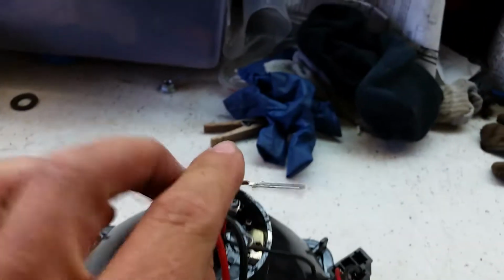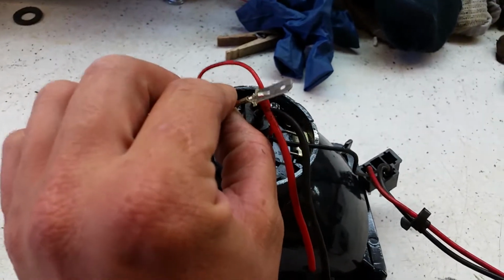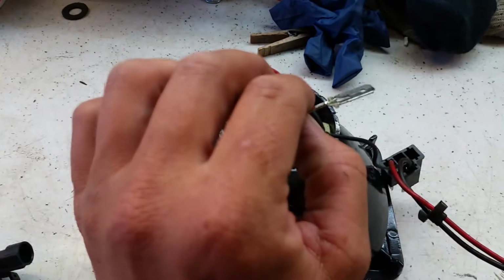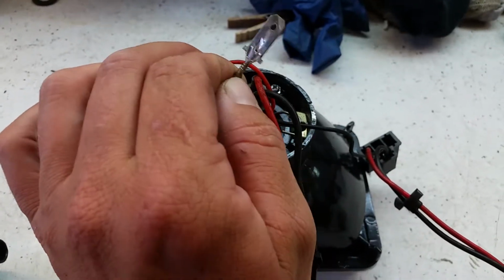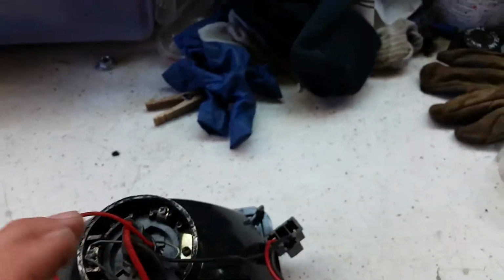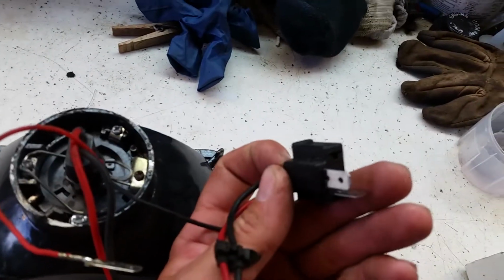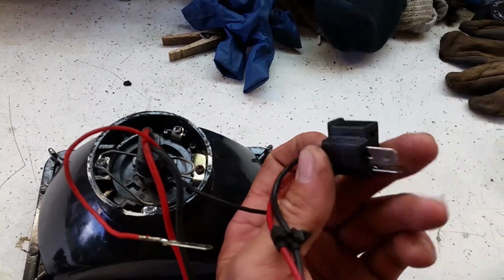Here, right here is the high beam connection. This has to be connected manually, at least for what I'm doing right now, manually to the original car harness to the high beams, and then usually I tape it or protect it from the elements, usually just electrical tape. But that ground for the high beams can still go to your ground on your original harness.